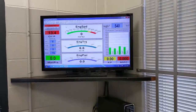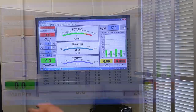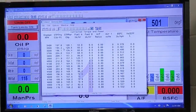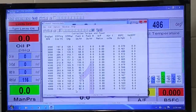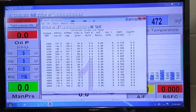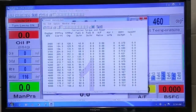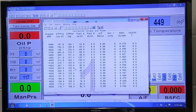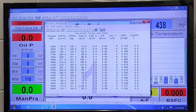Exhaust temperature's coming down. Somewhere weird, going. Then they find their spot. Didn't make any more power or nothing. Actually lost torque. Yeah, look at it, lost torque even. So look at it, straightened the brake specific out a little bit. Yeah, except for right in here where it vibrated again. There must be some harmonics in there or something that are shaking that thing to the moon. But, you know, we probably lost power, so I'm going to go the other way with the timing, I guess.